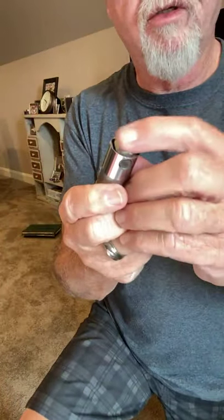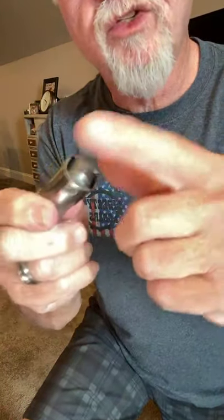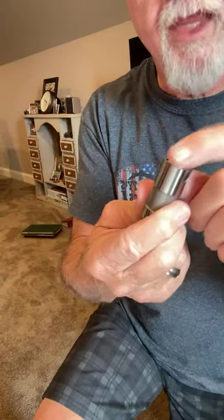Now, if you've got a solid lifter car, like a 327 Chevy with a 30-30 cam in it, and you have solid lifters, for instance, you're going to burn up the lifters and burn up the lobes because you're going to be just skidding this stuff along. The Harley works good because we have roller lifters. We have roller bearings in the crank. And I'm going to share that with you in a minute. But that's my idea on why we do the heat cycles.